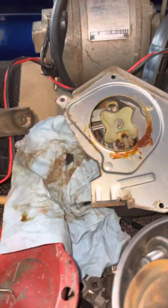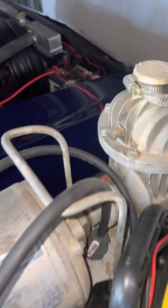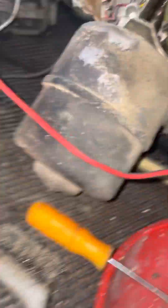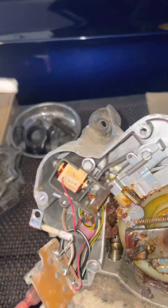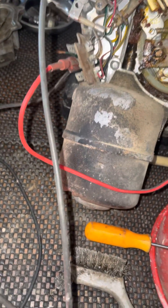Here's a step-by-step. You get some wiring — here's your hot, you see how I have it in the middle, and my negative is connected with this. So I have my power and my negative connected. I bring it over and make a jumper cable. I have this alligator clip coming from the same ground, which is coming from the battery post. I have it connected somewhere where you get a good ground, and then off that same wire I make this wire.